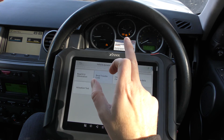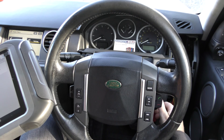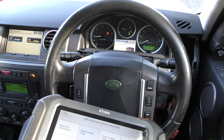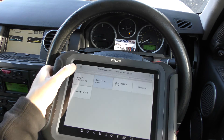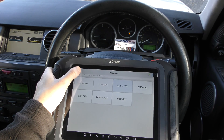This one is a little different — the warning lights will stay on even after we send the clear command. If we go back to Read Trouble Code, there are no trouble codes there, so the faults have gone. The warning lights are still showing simply because all you need to do is turn the engine off and then back on, and you'll see these warning lights disappear.